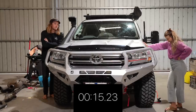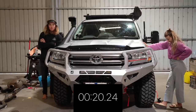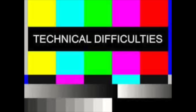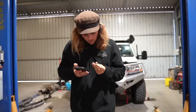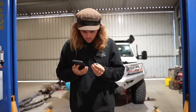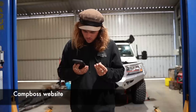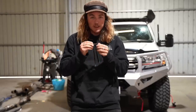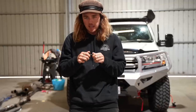Normally it takes three minutes, but mine's already cut out. So as you've seen, the CampBoss deflator cut out well earlier than the set PSI. I immediately jumped to the conclusion that I set the deflator up wrong — even half a turn or a quarter turn can change the PSI output. I checked everything and went on the Jace Andrews CampBoss website and set it up the same way he has. It's cutting out at around 33 PSI, so it's only letting 7 PSI out of the tyres.